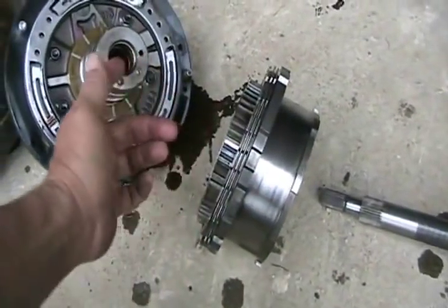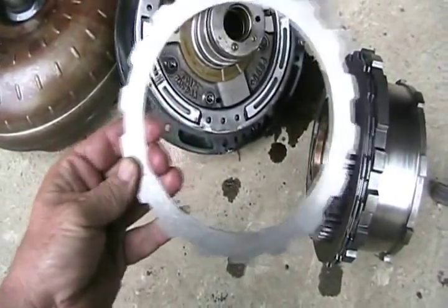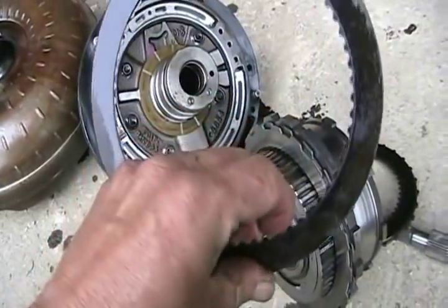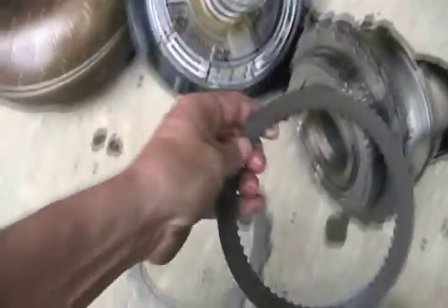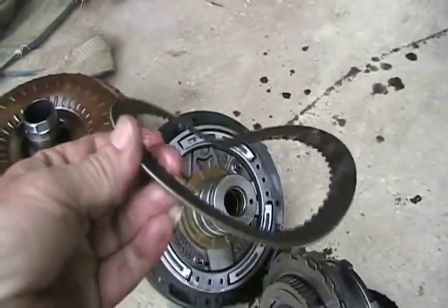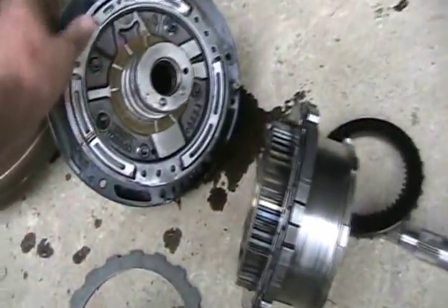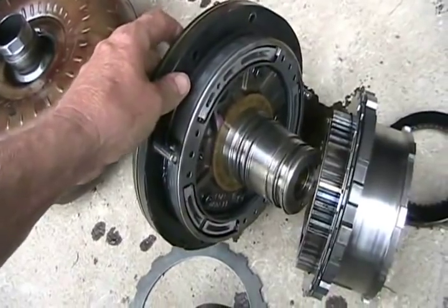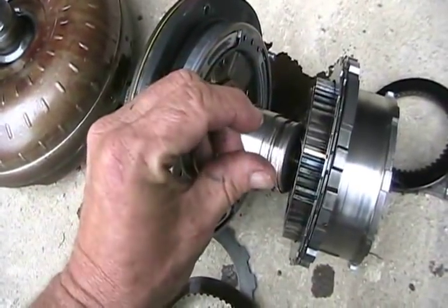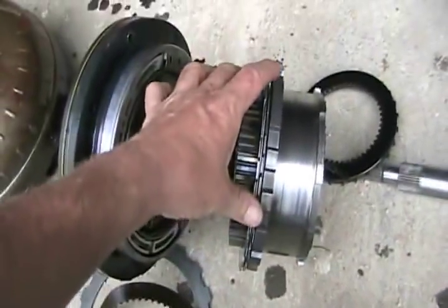This is the next part inside the transmission. Here we have a wet clutch — a metal friction disc and a fibrous friction disc, not made out of metal, made out of something like the stuff on a brake pad. There's a whole bunch of them here. When the transmission wants to go to a certain gear, these aluminum pads — all three of them — move out just a little bit, push on this clutch, and squeeze all the plates together. That causes a certain part of this rotating assembly to engage.